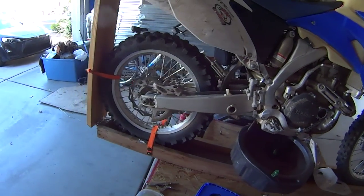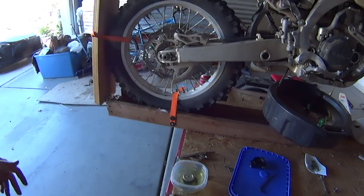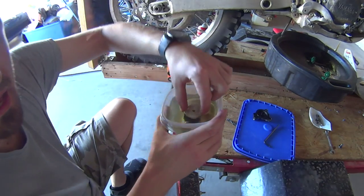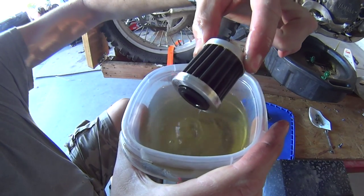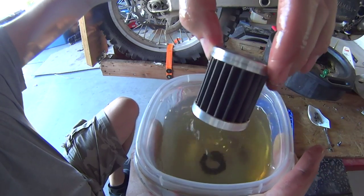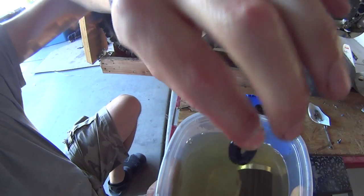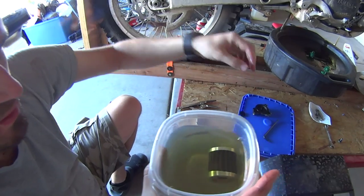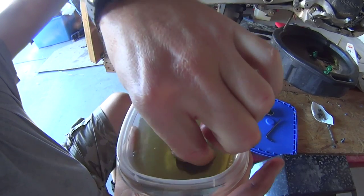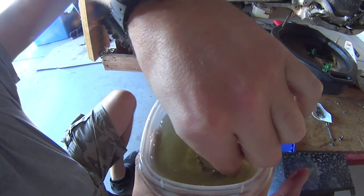It's in the gasoline right now. Here's the oil filter and I am basically cleaning it. When you put it in the gasoline you can clean it with car cleaner or other things, but I like to use gasoline just as a proof of concept. There's a rubber washer that's not supposed to go in there — that's my bad, but no harm done. This is the stainless steel reusable filter and I just let it soak a little bit to take all the oils out.